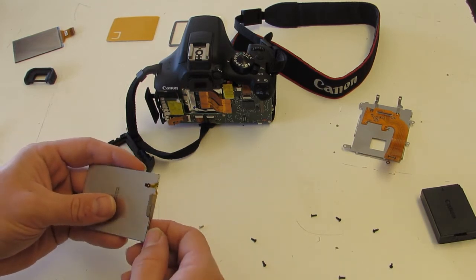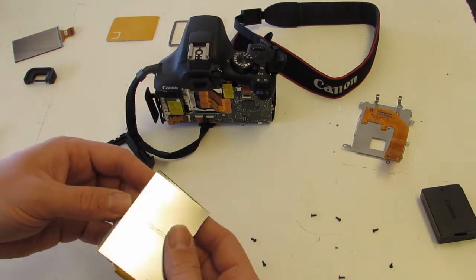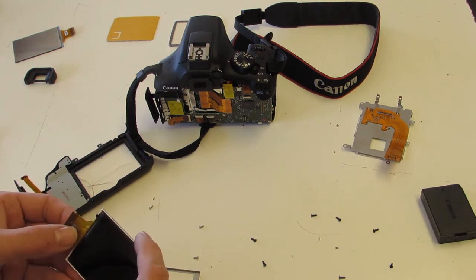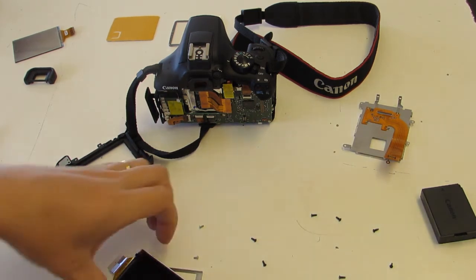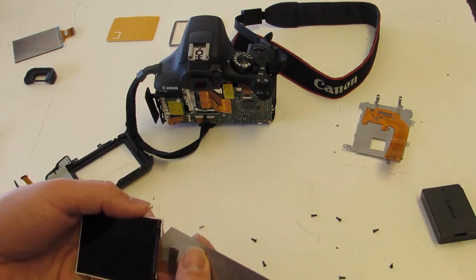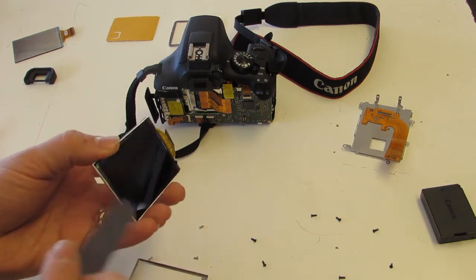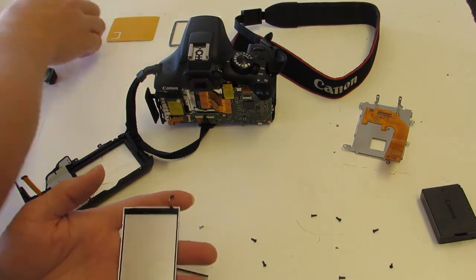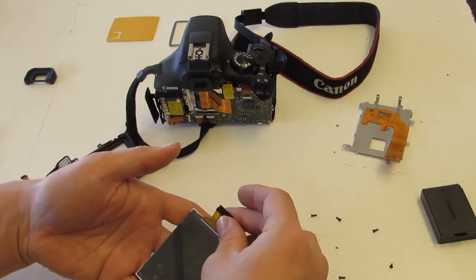Be careful that you're not bending the whole thing, because you don't want to break your backlight assembly. I'm going to use a spudger just to get underneath the edge and lift it up. This LCD is already broken so I don't really care about it, but I don't want to break the backlight. There we have it — fully separated; it wasn't glued in or anything, just pressure-set. I'm going to lay the replacement in there.